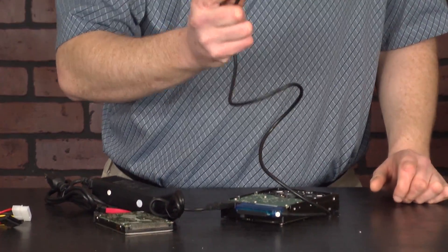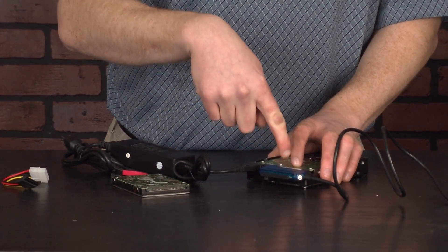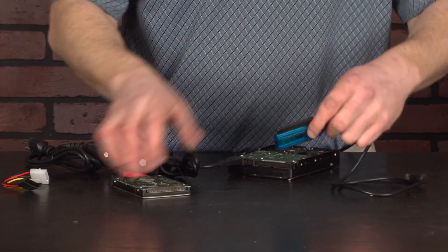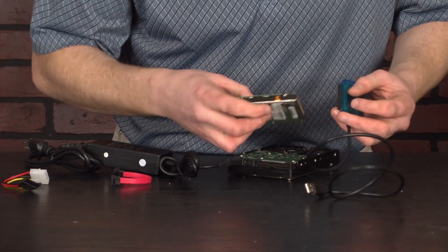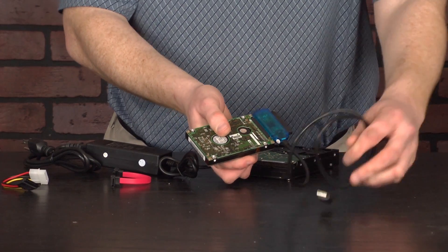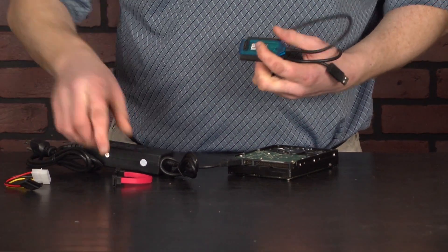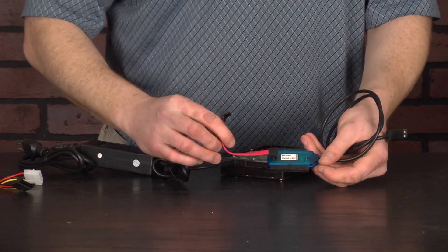All you're going to do from here is connect the other side into your computer — that's a standard USB connector. If we try to use the wrong side, you'll notice it's not going to line up — too many pins and it's not lining up. On a laptop style hard drive you have the one little cutout there, giving you a guide as to where the pin is going to go, and then it simply connects right into the drive. In the case of the laptop style we do not need the power adapter — it gets all the power it needs from the USB end. For a SATA style drive we would simply connect the little red SATA cable, plug it in to the base of the cable unit, and then plug the other end into the hard drive.